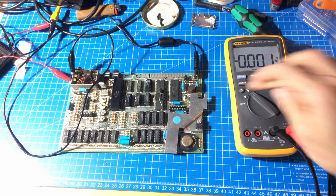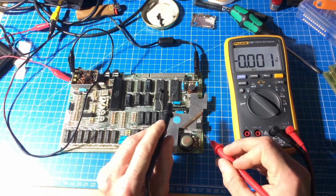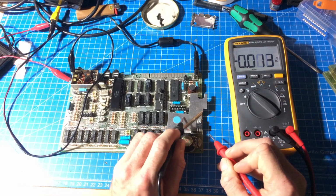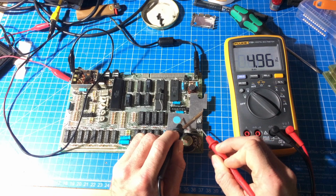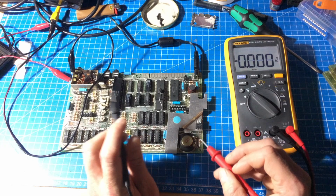So here's what we get. It's blinking. It's not too bad, I guess. So we are at 9 volts approximately. That should be a pretty clean supply of 9 volts there. And we're drawing 700 milliamps. Okay, so let's get some voltages. Got this running by plugging in the plug because it doesn't have a power plug. This should be ground, the big shielding, and this should be 5 volts. Yeah, which it is. 4.96 something on the regulator, so the regulator is probably fine.